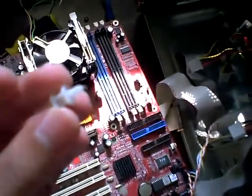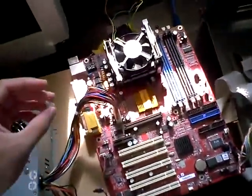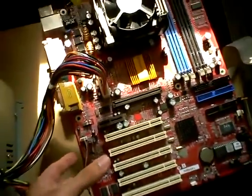As you can see, they have a screw bit, and the screw bit is inserted into the mounting holes of your computer case. It's very important that you place them in alignment with the mounting port holes of your motherboard. You may have to, on numerous occasions, physically take your motherboard and try to align it with your case to see where these support stands go.